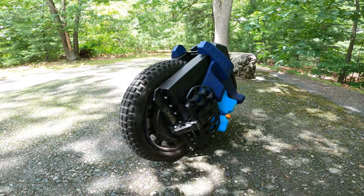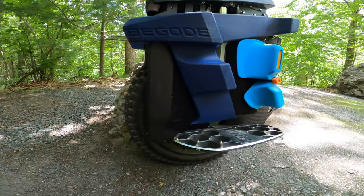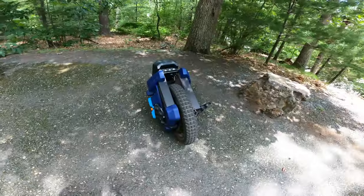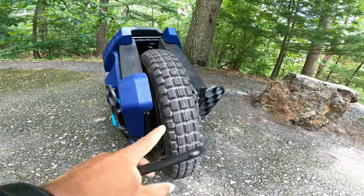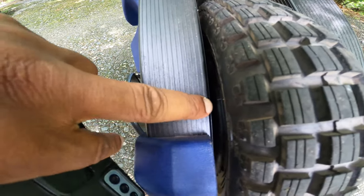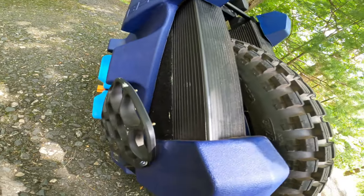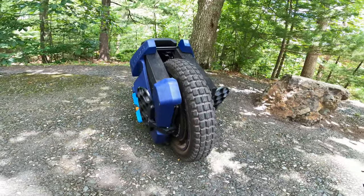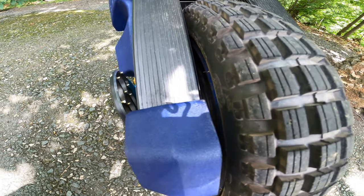Clearly, Begode intended to satisfy the requirements of both street riders and some trail riders, but I think a more rounded knobby tire would have been a better option. These are some minor things to complain about, but the sticky tape on the pads is subpar — you will have to use Velcro to get them to stick properly. Also, while the tire on this is easy to remove, it's not easy to replace. There's a metal spacer that goes between the frame and the motor; once you remove all four motor bolts, this spacer falls off. To put it back you have to remove one of the battery packs to align it with the motor bolt holes — that can be annoying. It would have been easier if there were recessed areas where the spacer could rest so you don't have to constantly fiddle with it while putting it back in.